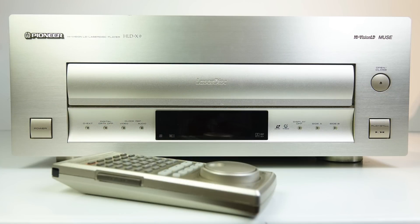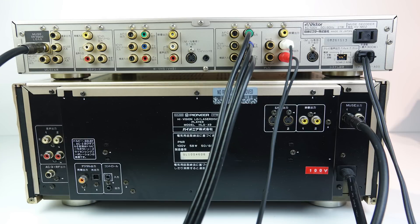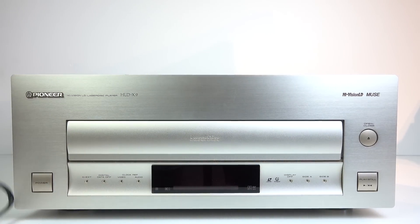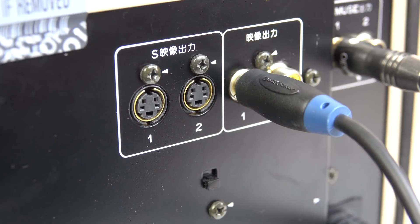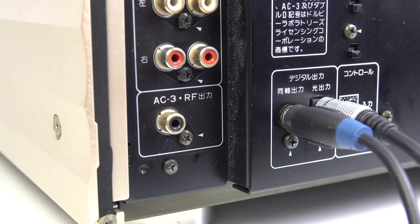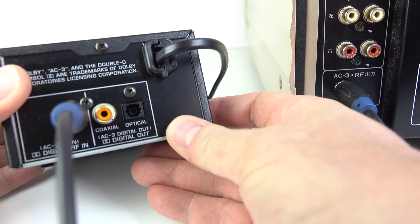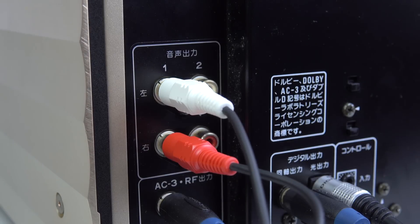Moving away from HiVision for a moment, let's talk about using this player to play back normal NTSC LaserDiscs. First, forget about using that Muse decoder - that can only take the Muse output from a HiVision player; it's not an upscaler, you can't use it to watch standard LaserDiscs over component. When it comes to normal LaserDiscs it's completely out of the loop. So to watch LaserDiscs you'll need an entirely new set of connections from the player itself. For video you've got a choice between composite and S-Video outputs. For audio on the digital side you've got optical and coax, and for Dolby Digital AC3 you've got an RF output from the back which you'll need to send through an RF demodulator before you can put it into a modern AV amp. And if you've got any LaserDiscs that just have analog audio then you'll need to connect up the RCA stereo outputs as well.